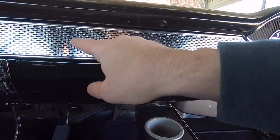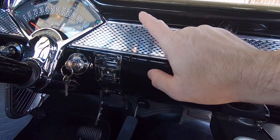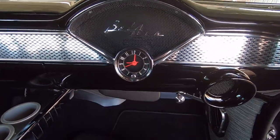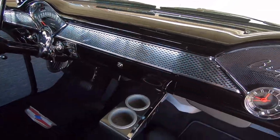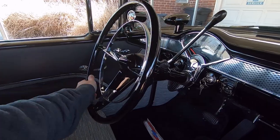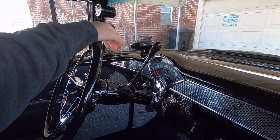There's a smooth dash trim — original Bel Air bow ties for a '55 — but I got the smoothie set since originals had radio cutout, cigarette lighter, and headlight switch cutouts. My headlight switch is mounted just underneath the dash. I made backgrounds for the heater, speedometer, and clock using original pieces. The speedometer has a bow tie behind it. All the chrome dash parts have been re-chromed. The steering wheel is a 16-inch Mutton Hollow instead of the normal 15-inch, since there's no power steering.